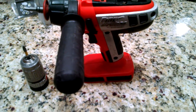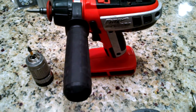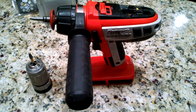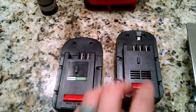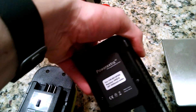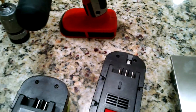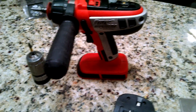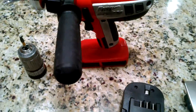For anyone who has these old Firestorm batteries, you know that the NiCADs that they came with are just absolutely terrible. They don't last long, they have memory effect, and they're rather expensive to replace in comparison. This is actually a PowerXtra NiMH replacement which is a 3000mAh, so it lasts a little bit longer but still has that memory effect. It gets a little worse over time.